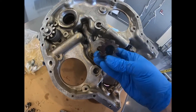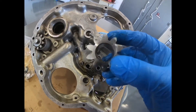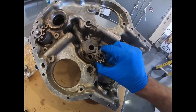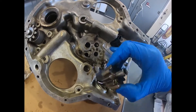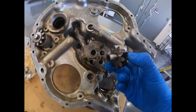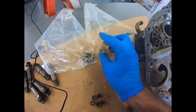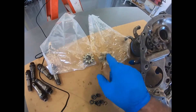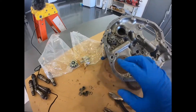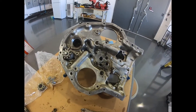So there are two gears. The drive shaft is keyed - you can see the shape of that, so it's keyed to that, and that actually is the driving gear. And then the idler gear here has its own shaft, sits in the housing, and is spun via that other gear train, so this one will get replaced as well. The new ones you buy as a set; they come in bags with preservative oil. We're going to clean those off, reinstall into the oil pump, pre-lubricate as we install them, replace the housing, put the nuts on, torque it, and safety it.